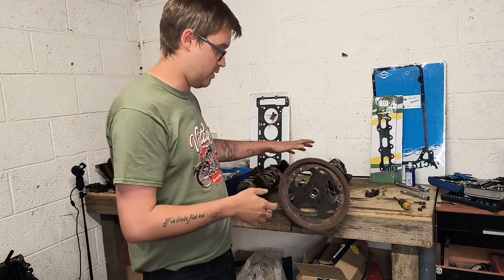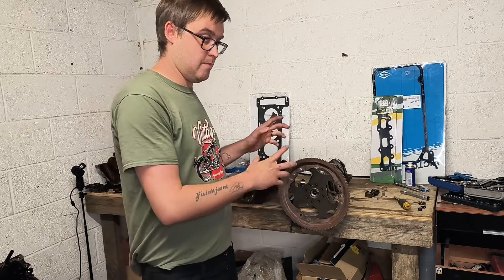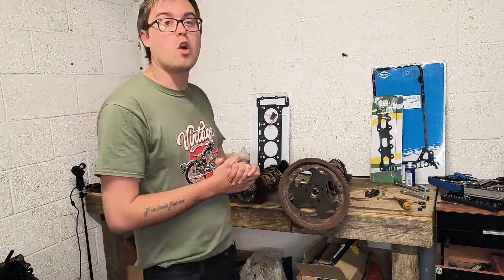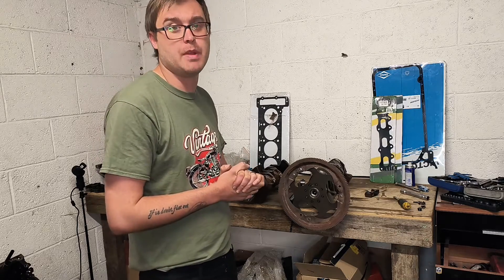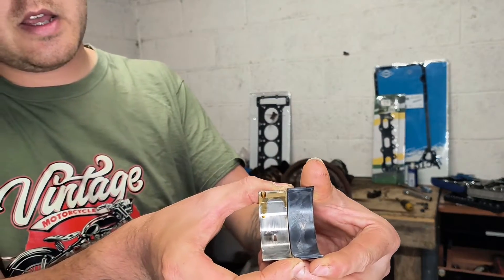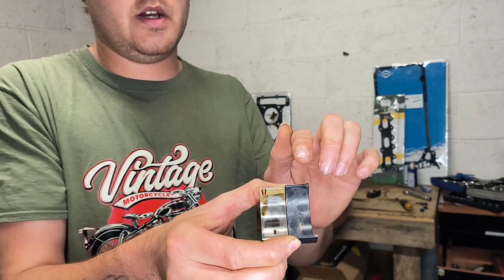0.1 of a millimeter is a reasonable difference you'd have to bear in mind when working with your crank if you went down this route. This is a reground crank so I can't modify it any further. I need to get a remachined crank because the bearings for the BMW engine are nearly 1.7 millimeters thinner. If you can see just there — look at how much thinner this bearing shell is compared to this one. This is your M111 one and this is the BMW S14 one.